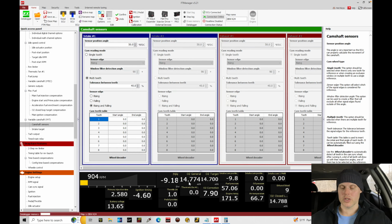So we're in a situation where the FuelTech doesn't wait for a certain period of time. It immediately goes after whatever the O2 sensor is reading, and it corrects that in the O2 correction. It was taking out 30%. That is not ideal. It definitely can create some problems for us.